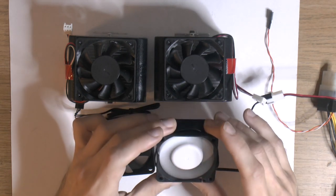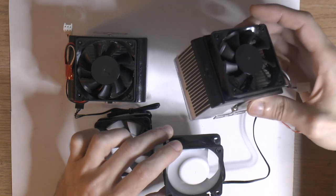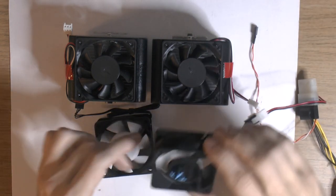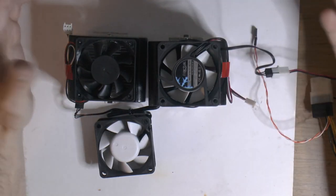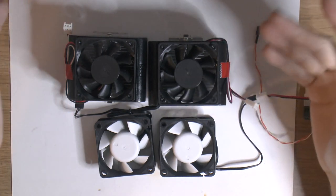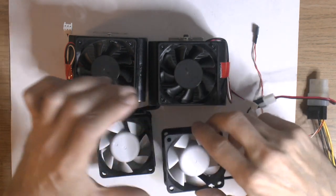These fans matched the specs of a cooler I had to replace a fan on — rated at 72 watts. Those coolers are actually slightly smaller than this one, so this heat sink is bigger and more efficient. I'm also thinking of a pull configuration for airflow reasons. Pull might reduce efficiency a few degrees due to laminar flow on the fins.